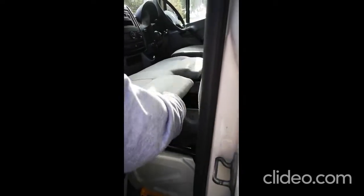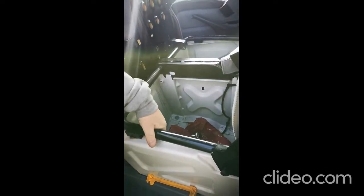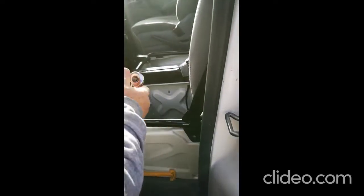To make this much easier, since we're putting new seats in, we're going to start by removing the twin passenger seat, which is held in with four T50 bolts - one on each corner, two at the back and two in the middle front and back. We take those out first.